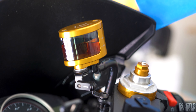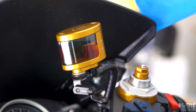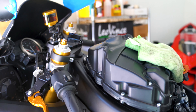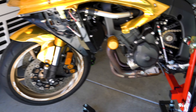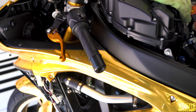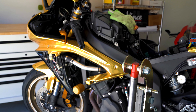This right here shows how dirty the brake fluid is — it's supposed to be a much lighter color but it's super dark. That brake fluid needs to be bled out — front and rear. We are ordering steel braided brake lines because the OEM lines are rubber and those are garbage. We're going to be putting in some custom steel braided ones, which are still coming in the mail.